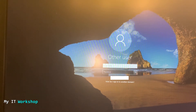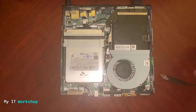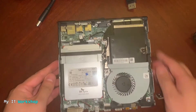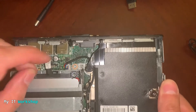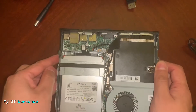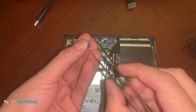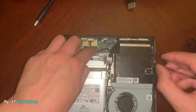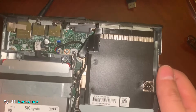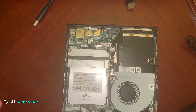I'm going to shut it down so we can put back the jumper and then the cover. Allow me a few more seconds to adjust my camera — you can see the fan is still spinning. I'm going to disconnect everything; I prefer to do that every time I work with the motherboard. Now I have the jumper and this time I'm going to use the pliers. I'm showing you the two pins where the jumper has to go. Using the pliers I carefully position it on the two pins, then with my finger I press it down gently — you don't need to hear any click, just press it down so it won't fall out.